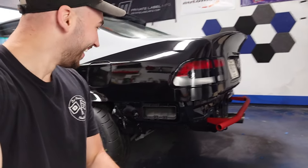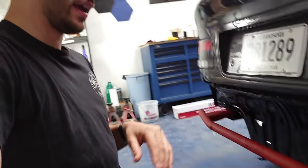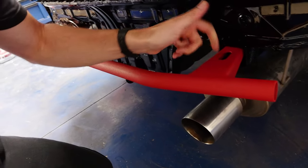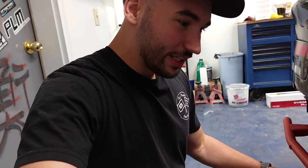I hope you guys are as stoked on these results and this crash bar as I am. Quick specs: it is 1020 steel, DOM 1.5-inch tubing, and it is 13-gauge steel tubing, but the mounting plate itself is 10-gauge so it's even stronger. All the welds are TIG welded — really good fabrication — and he even has little TIG weld tacks holding on his Doryoku logo, which is a really nice touch. It's got slots for your standard T-hook towing adapters, plus an M12 by 1.75 threaded bung for a threaded tow hook. You get a discount on this bar if you already purchased the front track bar. There are three tiers of powder coating options and you can do zinc coating as well so it matches the factory zinc coated Honda hardware. I'll include a page at the end of the video with all the frequently asked questions and you can contact Charlie Moa at the Charlie Moa Doryoku Instagram.